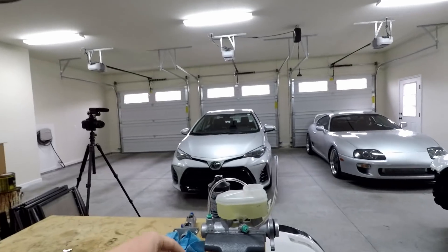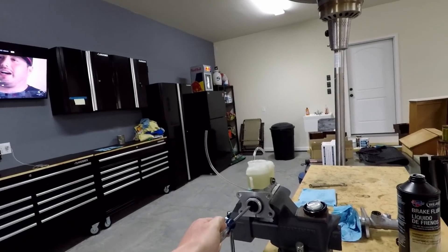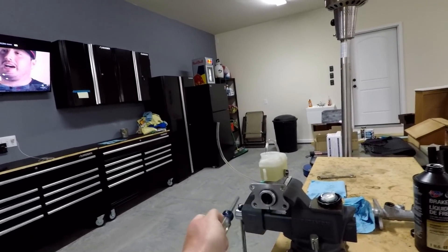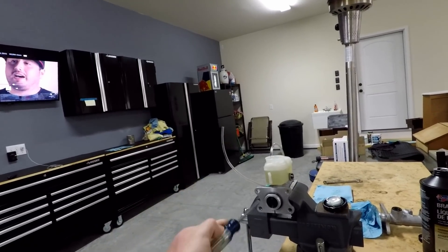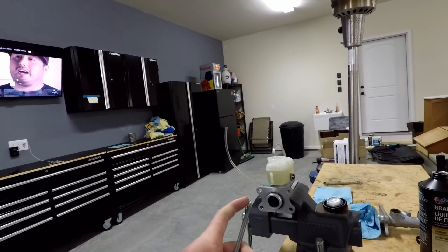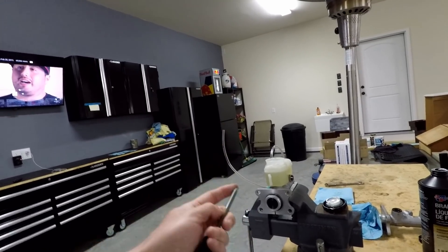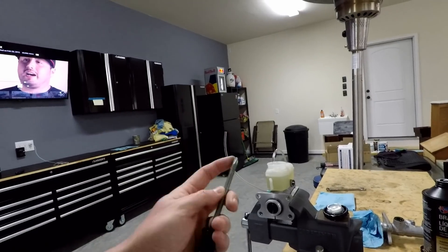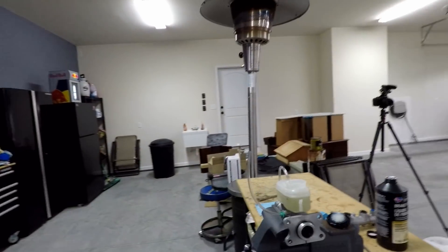You can force the air through the car the other way, but it's going to take a ton of fluid and a lot more time — who wants to do that? This is a much easier way. What I'm going to do is take my screwdriver and insert it in the hole. When you do this, be very careful — you don't want to slip left or right and damage the rubber fitting inside the cylinder. Ideally you'd want something with a round edge, not a sharp one. They actually make a proper tool for this that I don't own, so I'm using this and hoping for the best.